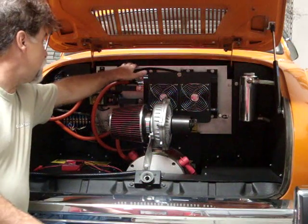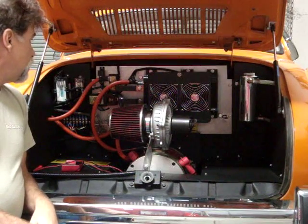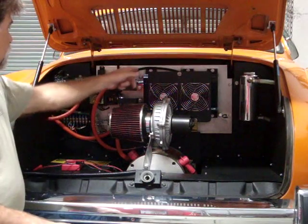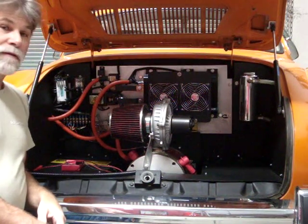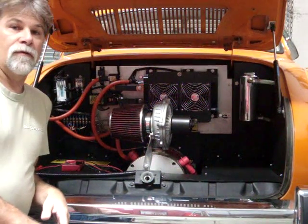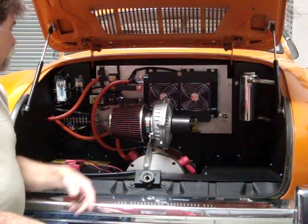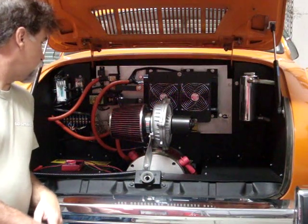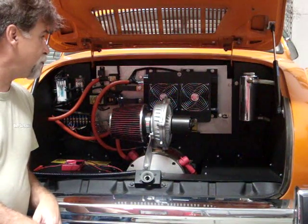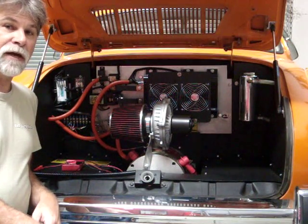And then we've got another heat sink, or another piece of aluminum, that we will notch, as it has to be done here on that new piece, put our mounting holes in it, and then the rest of the layout will be reconfigured for the Evnetics controller, including the throttle layout and so forth. So there's accommodations that will be made, and if you stay with us, we'll share that with you.